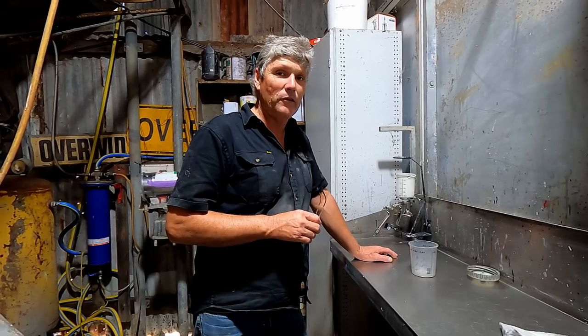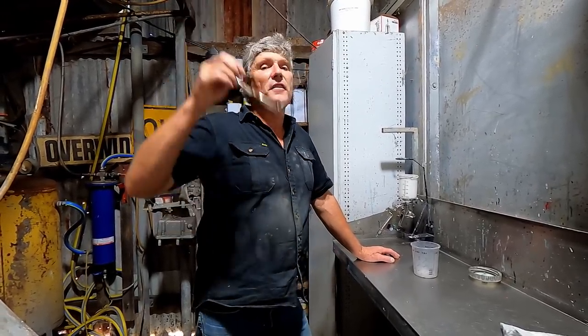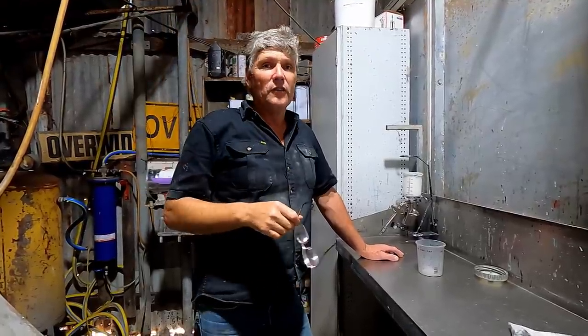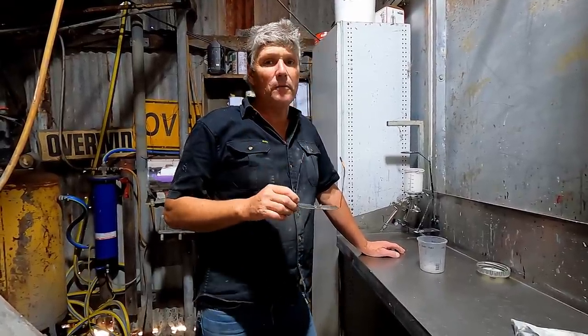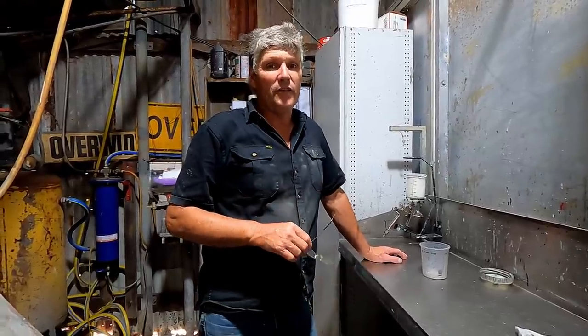The weather report, I just went and looked at it, it's 36 degrees for about now, and we're under a tin roof in this shed, so it gets pretty hot in here. And once I start the booth up, it's going to draw the hot air from above the booth and below the roof through it. So it's going to be cooking inside the booth, which is not a great thing because we have an optimum spraying temperature of 25 degrees. So we're 10 degrees plus above that already.